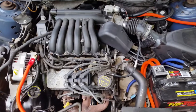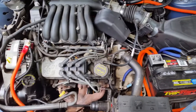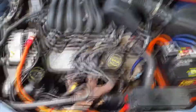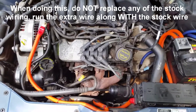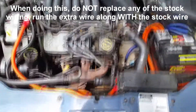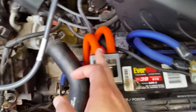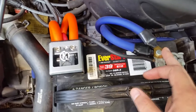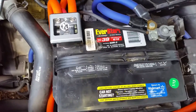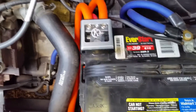What is the big three? The big three is basically upgrading the flow of electricity through your electrical system in your car. I would recommend using zero gauge wire. It is of course huge, but it also helps with the flow better than a smaller gauge wire would. Basically, all it is is your power and your ground. Not only will this help with headlight flickering when your bass hits, it also will help the overall general electrical flow for the rest of the electrical system in the car as well. So it is an improvement all around.